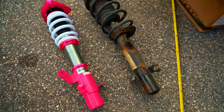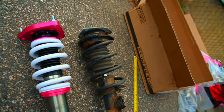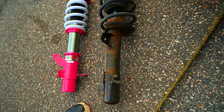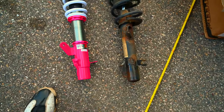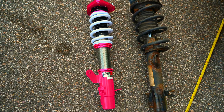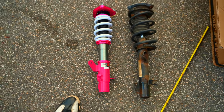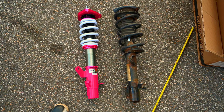So, just as I thought, simple process, a little hammering, a little penetrating lube, and it came out pretty easy. Looks like this front shock was kinda beat up too. I don't know if they're supposed to have that weird flat spot over there or not, but it almost looks a little bent. Anywho, determined to take 2 inches off the coilovers total install height. This stock one was at 22 and a half inches uncompressed, so I left this one at 20, just to close up some of that wheel gap. I'm gonna throw these on and see how the front looks.